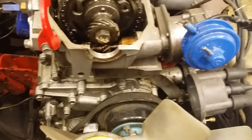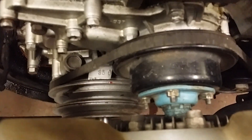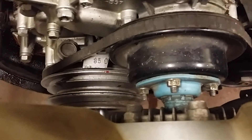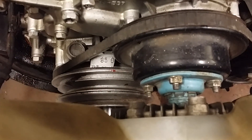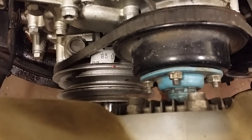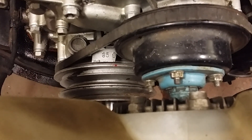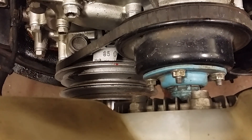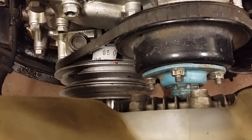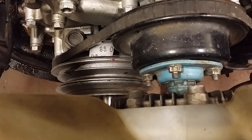The other part: if you did this properly, read your stuff — it'll tell you how to do it. If you look down in there, you can see the harmonic balancer pulley down in there. There's a little red mark I put on it, and you can see some numbers. You'll see a zero, and next to that you'll see an 85. You see that zero, and then to the left of the zero you see a couple little marks. That's your initial static timing, which is advanced a little bit.